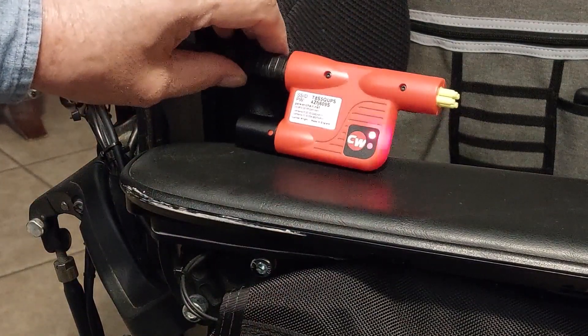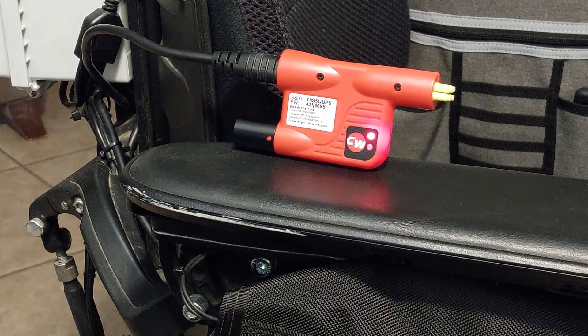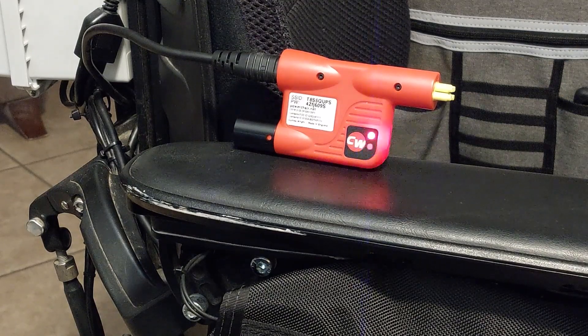The dongle's red LED starts flashing when it gets plugged in. When the dongle is booted, the red LED stops flashing. The flashing blue LED means the dongle's Wi-Fi network is running but no computer is connected to it. Quickly connect your computer, tablet, phone, toaster, etc. to the dongle's Wi-Fi network. You know your device is connected when the blue LED stops flashing.